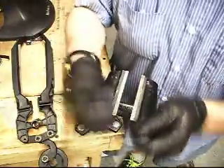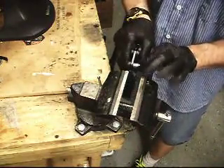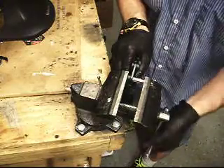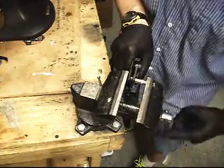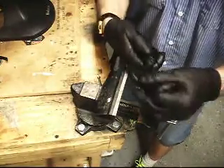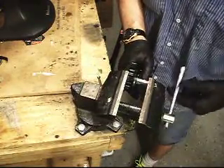Watch when you press down in the vice: don't press it down totally flat. You want to press it snug, and I'm going to show you how to test the play in it, because if you press it too tight it will bind up the system. If you do press it too tight, a little bit of tweaking and wiggling should bring it out. Take the nut, put it on, crank open the vice a little bit, put it right over top of the press nut, put the tong into the vise and crank it down. This will come with experience doing it over and over. I'm going to do the three that are all facing one side first — you can do it in any order, just don't forget which ones you've done so you get every one.